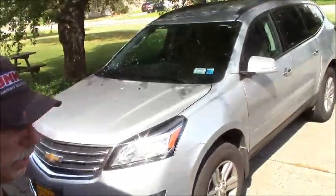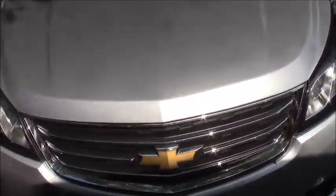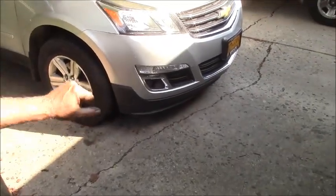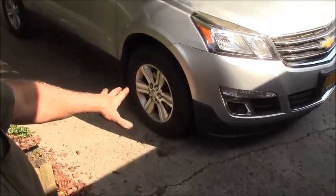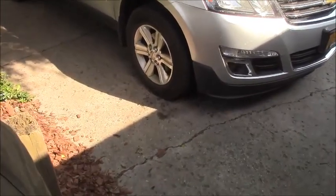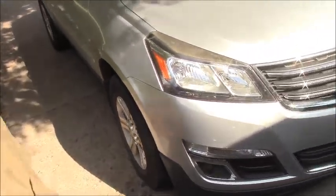Alright guys and gals, there she is. The tires are on the ground again. I haven't driven it yet, but I have no doubt. When you do a front brake job like this and you push those pistons back in, make sure that when you start the car, you slowly pump the pedal back and forth until you feel the pressure to pump those pistons back out into contact. Otherwise, your first couple of brake stops will be pretty hair-raising if you stop at all. Stay safe, God bless. We'll see you next time on Bob's Barn Workshop.